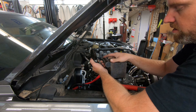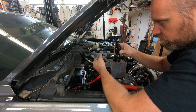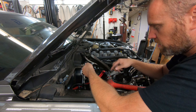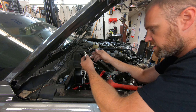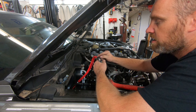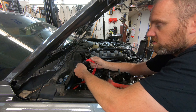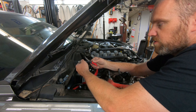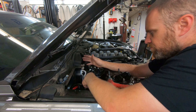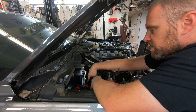Basically, you throw your wires in there, put the tool on, and whack it with a hammer nice and hard — it crimps the terminal down. You're supposed to do it on a floor or bench. Since I didn't have a place for that and already had the cable ran, I grabbed a giant iron block as a back weight, threw it on, and hit it with a hammer so I didn't cause any issue to the car. Once it was crimped, I went ahead and threw some solder in the hole, heated it up, and soldered it in really good. Make sure to solder it quickly because the heat transfers through the copper cable and the solder will travel up the cable if you're not fast enough.